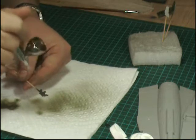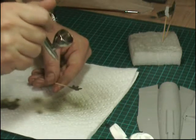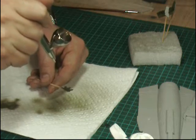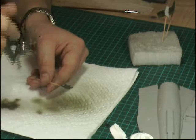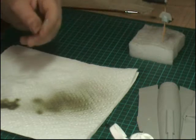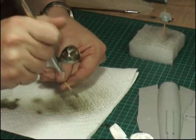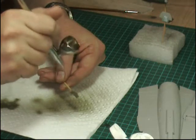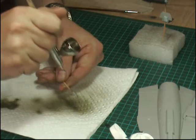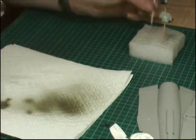Just remember, when you're spraying this with thin paint, if you've got that thing where the paint is literally just coming straight off and won't stick to it, you're going to need a primer coat. Or when you're going in, make your air pressure a little bit higher than you normally spray. You can probably hear how high I've got this. Just dust it on and then cut to air, next one goes on, cut to air, and so forth, just keep working at it. Because if you go in there too heavy with constant paint, you'll flood the area, and before you know it, it's a mess and looking horrible. So we just get in there like that. That one's okay as well.